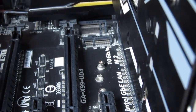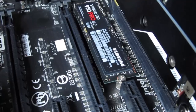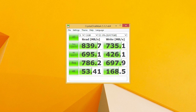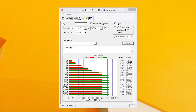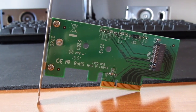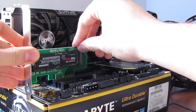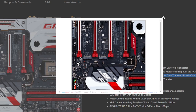I've put these two beasts to the test. The first benchmarking scenario I did was on the M.2 slot on my Gigabyte X99 UD4 motherboard, which has only 10Gbps of bandwidth reserved for the M.2 connection — theoretically around 1250MB/s, but I only got around 600–800MB/s for read speed on the 512GB drive. I then brought out the big guns: a PCIe 3.0 x4 M.2 adapter, which offered 32Gbps of bandwidth and allowed me to fully unlock the performance of both modules. If you have a newer Z170 or some of the latest X99 motherboards, you'll likely have an M.2 slot with PCIe x4 enabled — 32Gbps of bandwidth — meaning you don't need this adapter.